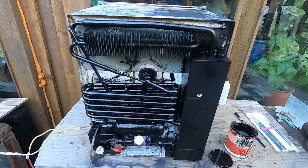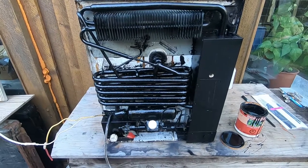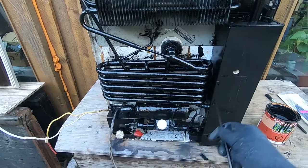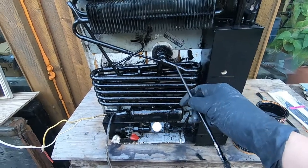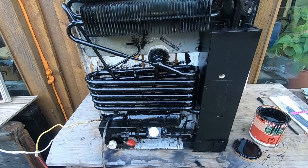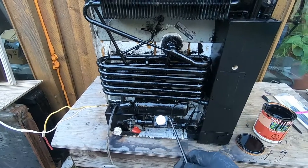I'm back and this afternoon I've got a little RV refrigerator here on the bench. I'm doing some preventive maintenance on it. These coils on the back, where the ammonia gas, hydrogen, and water circulate through that process — if you've got an RV where the fridge is more than five years old, you'll start to see a lot of rust develop on these coils. They're made of steel and they are painted from the factory.